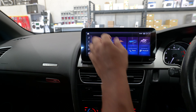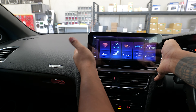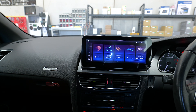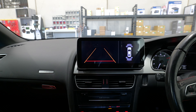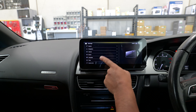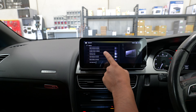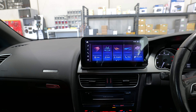The screen is in. The very last physical step is to open the two flaps at the top back of the screen and put the screws in to bolt it down. Before that, a quick settings note: if you have an original factory camera, go to Settings, then System, then Camera Selection, and change it to OEM.